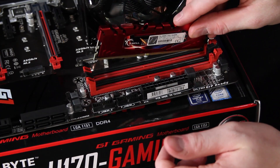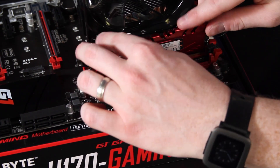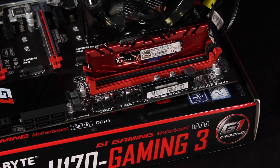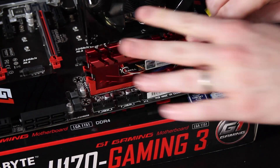Can you talk about what RAM you selected? Is this commodity RAM or a brand you like? We picked G.Skill 8 gigabytes of DDR4 running at 2400 megahertz. That's fairly low on the frequency side of things, but again, trying to keep things at a budget. When you increase that clock speed, you tend to ramp up the price at a much higher rate.